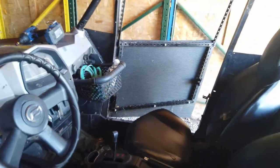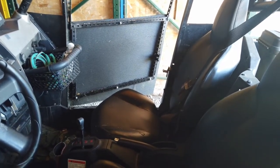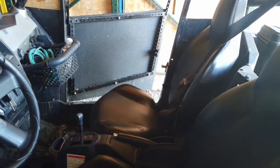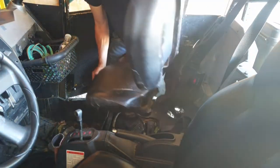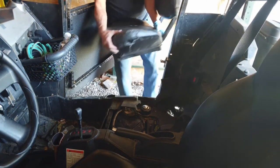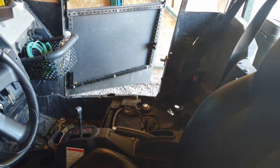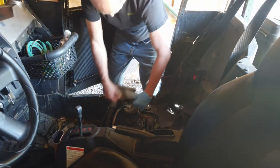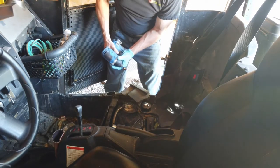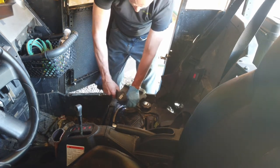And we're gonna get this fuel pump changed out. And hopefully decent recording on it. Alright. This is a CF Moto Z6. And right now, this is the third fuel pump that I'm putting in right now. And I checked it the other day, as I showed you in that video. It's only got 20 PSI. And it needs 45.